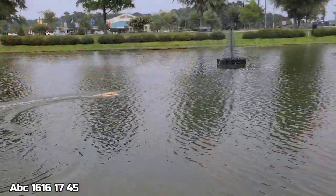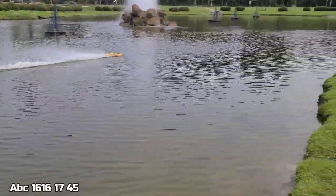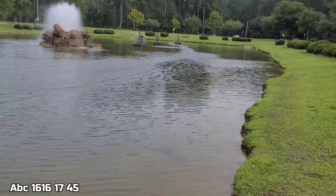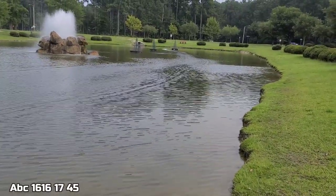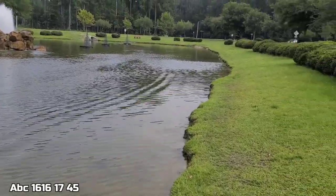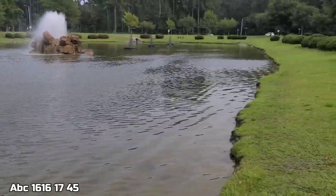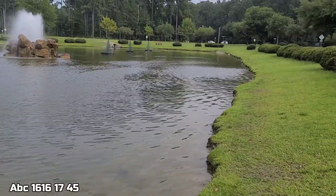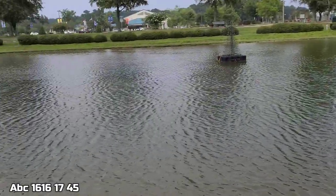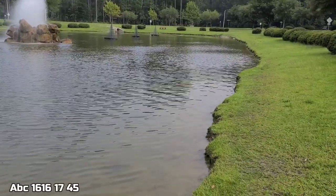The reason I'm doing this test is I'm actually looking for a good oval prop for this pond - something that's not gonna prop walk the boat out real bad and have some odd characteristics. I might throw in testing an 18/16 into this video as well. I've already tested it and it's way too much prop for this pond. The 17/16 in this small pond actually worked out pretty good - 43 millimeter. Let's see what this 16/16 does.